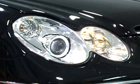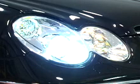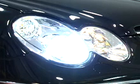Also, some models may be equipped with the bi-xenon feature. This simply means that both halogen and xenon light will be used for high beams. Externally, the headlamp assemblies look the same. The only way to tell from the exterior is to function check the headlamps like this.